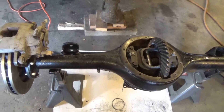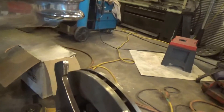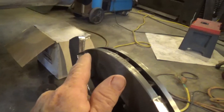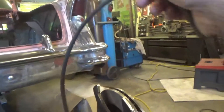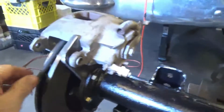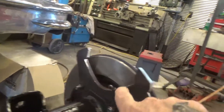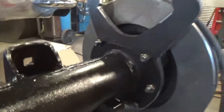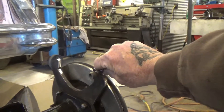I'll probably get her in there sometime this week. I used a little sander and sanded those down just ever so slightly so the calipers fit in there nice. I'm using a piece of spark plug wire, putting it in the groove there as a spacer to hold the caliper up to figure out where the holes are going to go. I'm going to drill and tap two 7/16ths fine holes in there for the caliper pins — these things thread in there and that's what holds the caliper on.